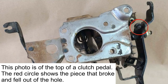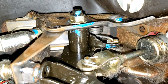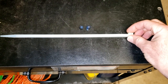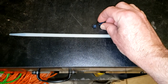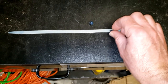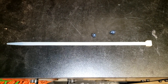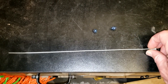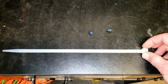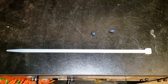The problem is that plastic piece I showed you dropped out, so we've got a hole up there that we need to plug with something so that when we press the pedal in it will depress that switch and we can start it. To fix this I've taken a wide cable tie — it's 5/16 inch wide, which is about the same width as the broken piece that came out of that hole. I'm going to show you how to fish this cable tie up through that hole so we can attach it, and then the cable tie itself is what's going to plug the hole.